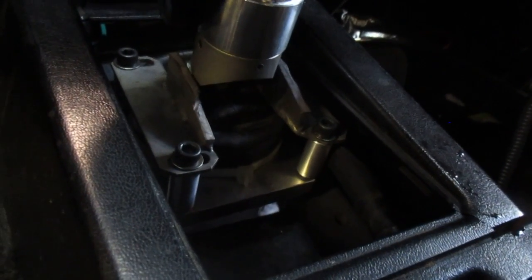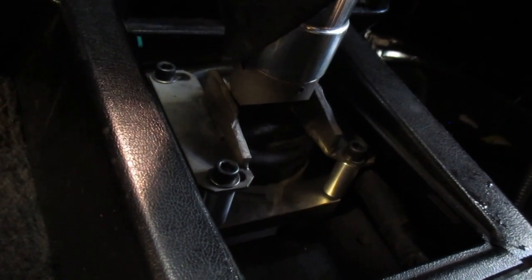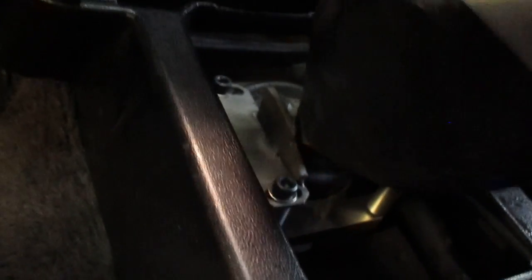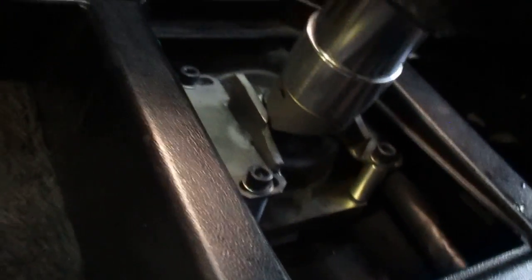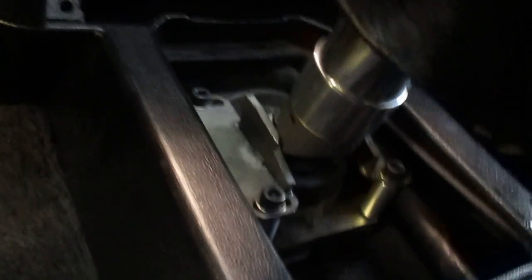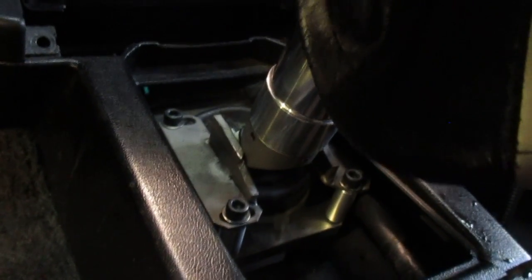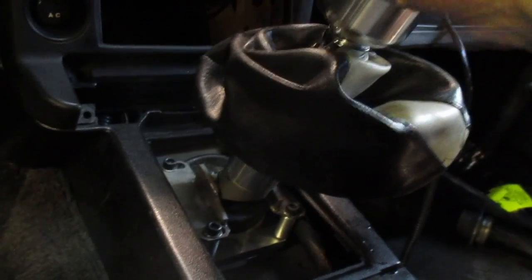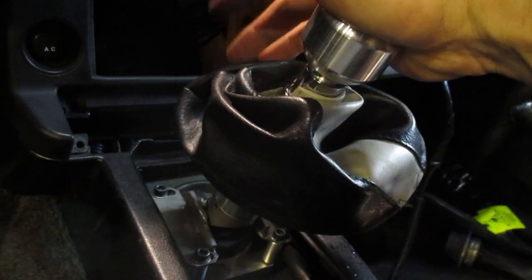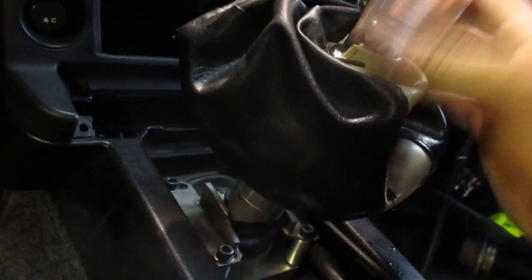It's going to be impossible to go into any other gear — you can't go back into first, and you can't go to fifth. When you go down to fourth gear you're still in the gate, so there's no possibility of going into second gear; it will not let you. For a dog box application like mine, where you can go into any gear really quickly and it can damage the motor by over-revving, this will prevent that.